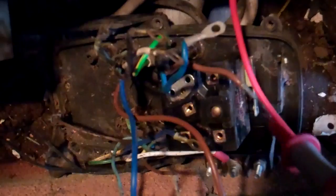So far we've got a dust band that doesn't matter. Let's put some of those links in here. Right, we've pulled all the wires off - given up trying to avoid doing that. That's the compressor wire on one of them, that's fine. Now normally you'd test all three of them but I've just done that anyway so I'm not going to duplicate that. That is start cap - so there we go, that's sorted out. Let's try this little relay on - I don't think that'll be alright. I'm not taking it apart but have a look - that is a bit earthy for something that's got no connections to it. So I think we'll have a look in there.